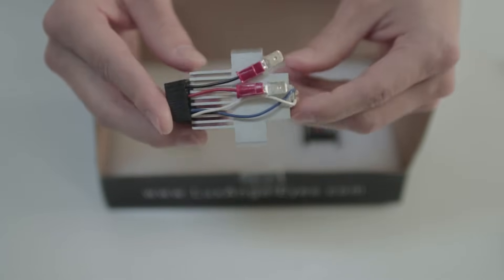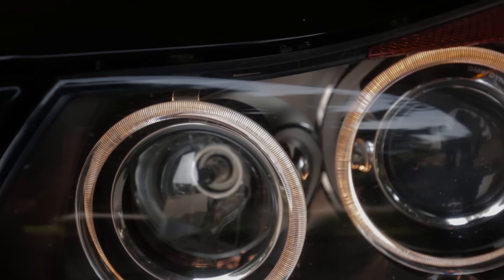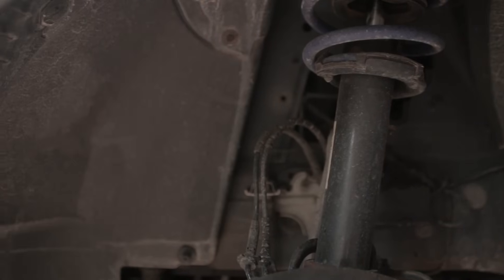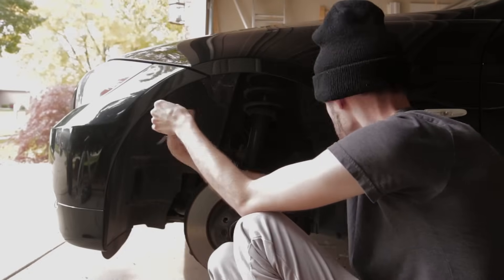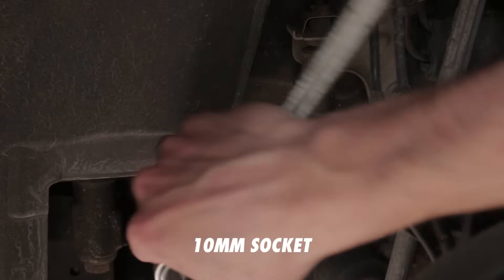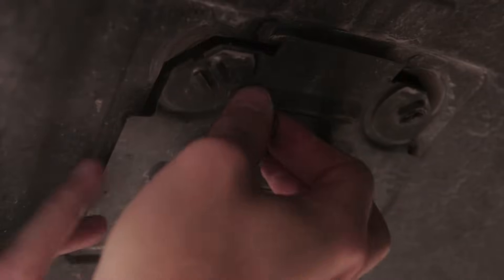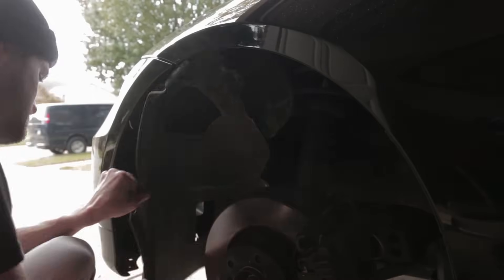These had really great reviews on all the BMW forums as being one of the best lights you could get for the E90s for the halo ring. So let's go ahead and put these in the car and see how they look. Jack up the car and take the wheel off. To reach the access panel for the lights, you will need to remove the fender liner, which is held in by 8mm screws. There is also a 10mm plastic nut. Use a coin to remove this fastener so that you don't damage the soft plastic. With all the screws out, remove the fender liner — it's really flexible, so don't be afraid to bend it a little to get it out.